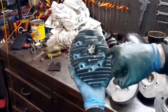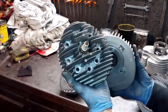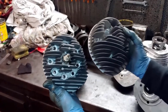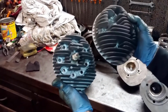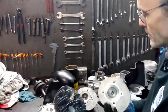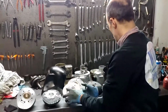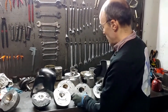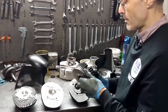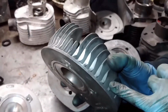Having all these bolts, on one hand it holds better, on the other, you understand, the radiant surface is smaller, because where there are additional bolts and screws, the fins are missing. There are pros and cons. Anyway, what to do? An operation that actually has proven effective is the realization of this milling.